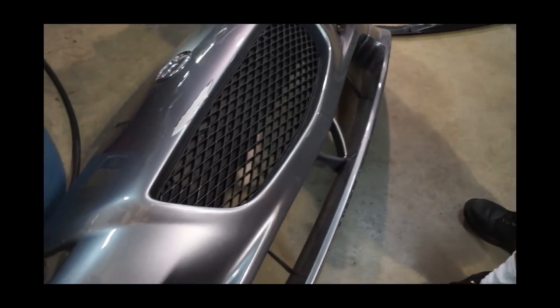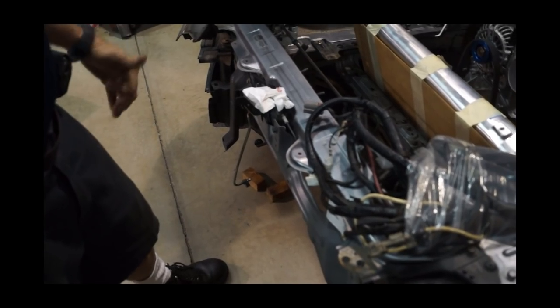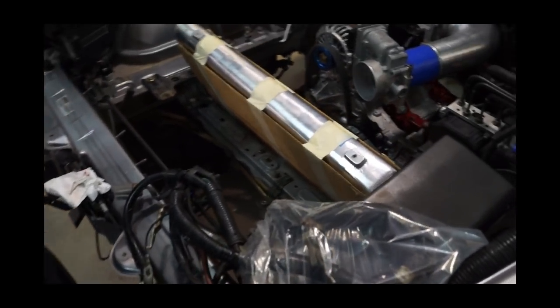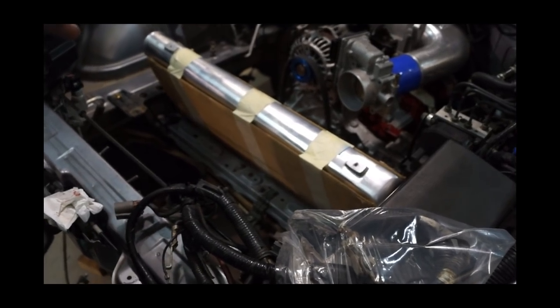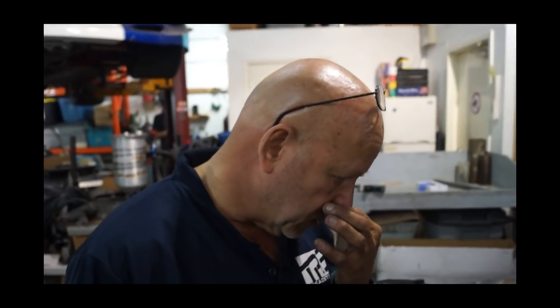So, like I said before, we're going to invert the location of the intercooler and radiator. We're going to put the radiator up at the very front so it has the maximum amount of impact air and heat exchange, because there's going to be a lot of guys that are going to want to squeeze some real power out of these things. When we're going through the headache of doing this, we're going to do it correctly — a truly state-of-the-art application.